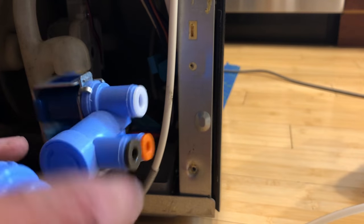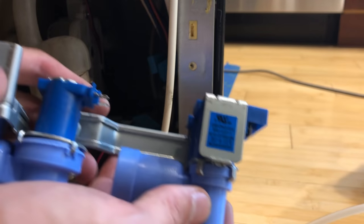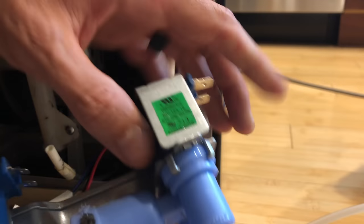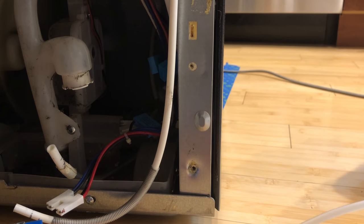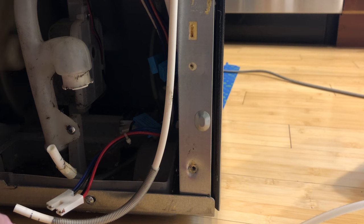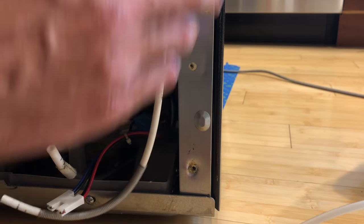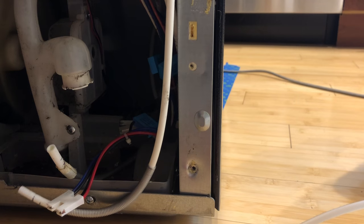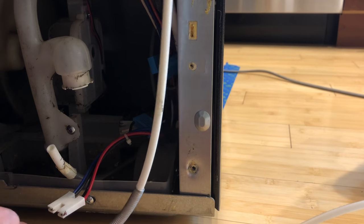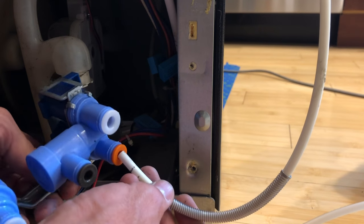You're going to hook this back up in reverse order of how you took it out. It goes in with the side that has three holes first. I'll start with the water lines in the back since they're going to be the hardest to get to. One thing I noticed about the new unit is the plugs face downward on the back, whereas on the original unit they faced straight out the back. The ice maker line goes into the back left - it's easy to identify because it's the tube that comes down from the top right corner where the ice maker is located. Since there are two different pipe sizes, put the smaller pipe into the smaller hole, which is on the left in its original position.